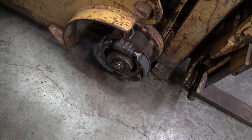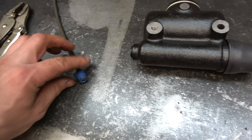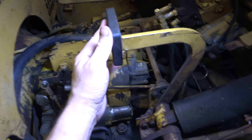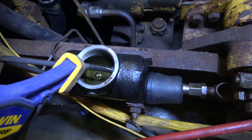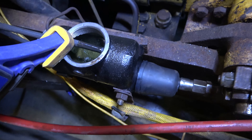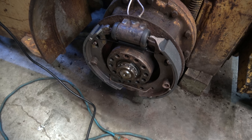Got both sides of the brakes together. I did have to tackle all these pivot points in the back and was working those free. Here's the new master — it actually sits in the machine level, so I think I'm just going to bolt it up. I'm going to bench bleed it before I hook up the banjo bolt for the lines. The brake pedal's free. Here is the master installed. I'm just going to keep going so there's no more bubbles in it. I'm just going to take some 60-grit and scuff up that braking surface on both sides, then put the wheel back on so I can pressure bleed this with the master.